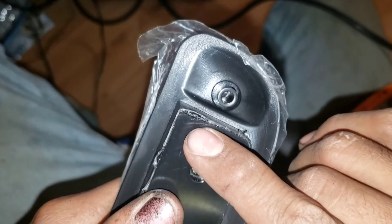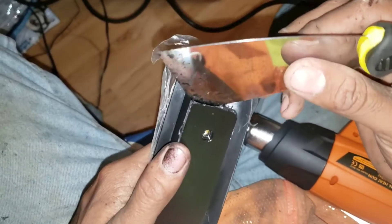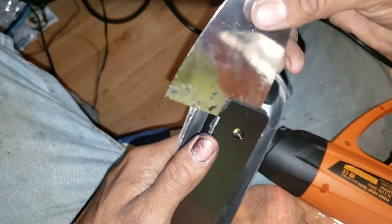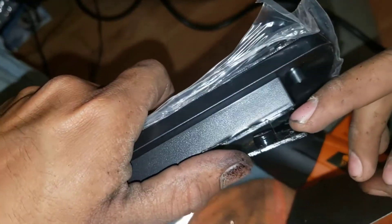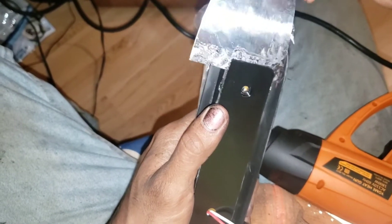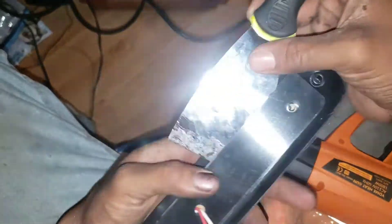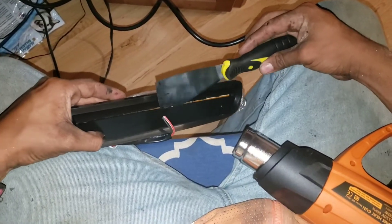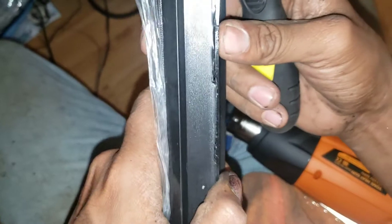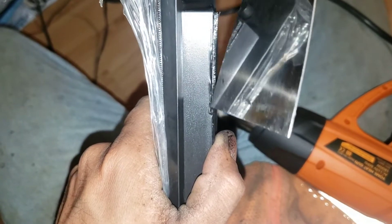You can kind of see a gap right here where it wiggled a little bit loose. Once you work that corner in first it'll pop up a little bit. It's not going to go straight in right here because that's the little screw mount, so whenever you're sticking this it's just going to get stuck. Start there, get it up till you hit that mount, then wiggle past it and move up and down, keeping your heat gun on it. If you just try and force it through, the spatula gets so hot it kind of warps things. Shimmy it instead — that's where I found that out.